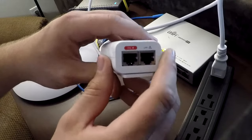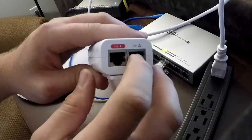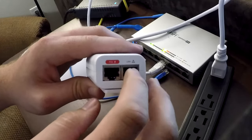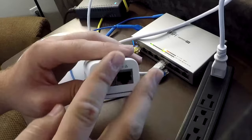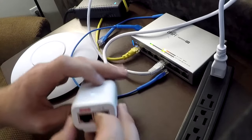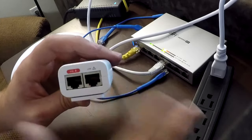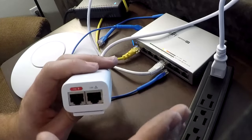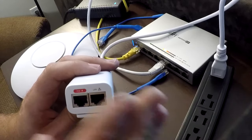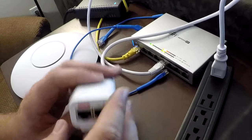As you can see, there are two ports — there's a PoE port and a LAN port. The LAN port you want to plug into your switch, and the PoE port you want to plug into your access point or whatever you want to power on through PoE. This makes it so you don't need a PoE switch, which saves you a little bit of money. I recommend still getting a PoE switch in the future, but right now this would be good for anybody just starting to get into networking.